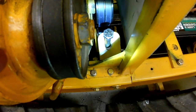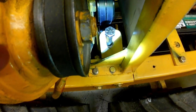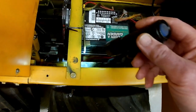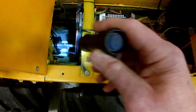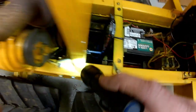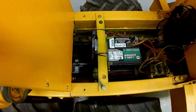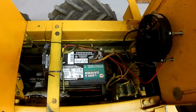That double belt pulley has two belts which run up to the double belt pulley on the engine. It's tensioned by this adjustable tensioner here. Right now I'm using a bolt to adjust the tension — the plan is to actually build a lever which would sit down here in the space between the battery and the frame, allowing me to tension the belt with just a flip of a lever. That's how power is transmitted from the motor down to the common drive shaft which connects the two axles together.